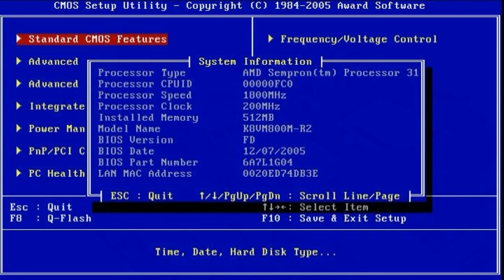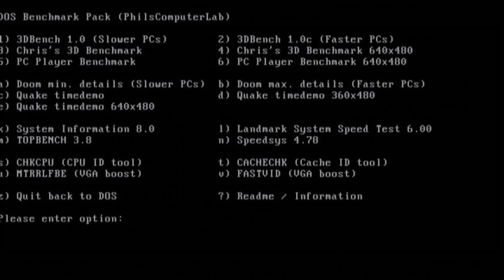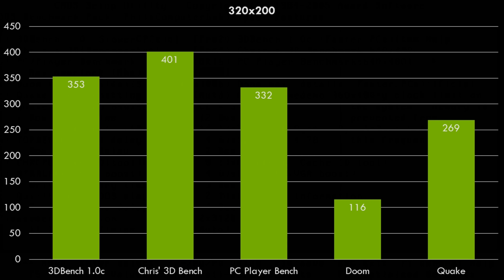So now let's have a look at the performance. We've got the machine running at full speed. So that's the Sempron 3100+ running at 1.8 gigahertz, and the RAM is running at 200 megahertz. And here we have results for the DOS benchmark pack, which you can download from my website. I will put a link down below in the description.